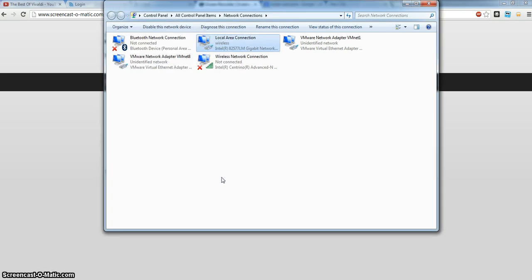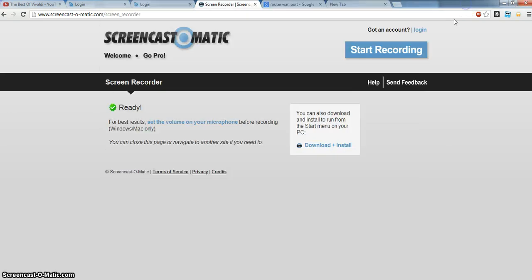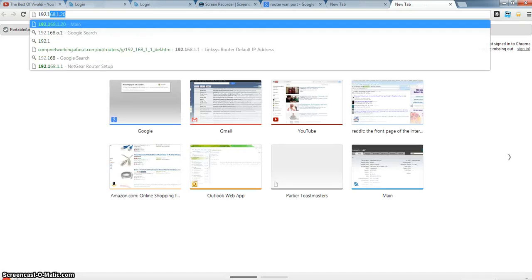Now you can connect your nanostation Ethernet cable to your computer, and what you're going to do is, if your nanostation is set to a default, like if it's just from the shop, you are going to type in 192.168.1.20 and you will get to the main menu, okay? Since I already changed my nanostation IPs, I will not do this. Okay, so let's see what I did. I kind of organized it a little bit.